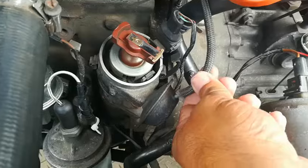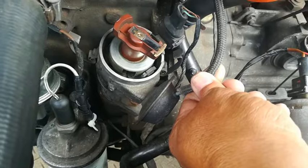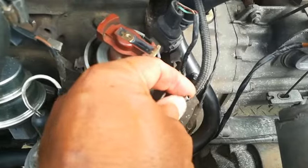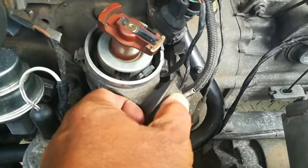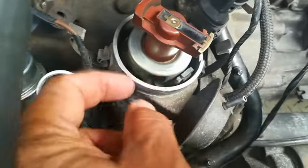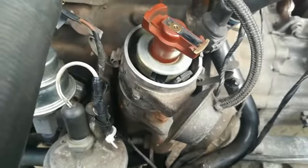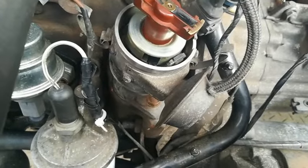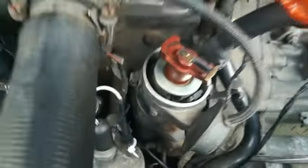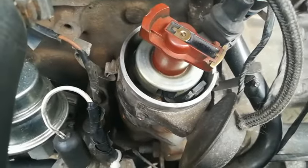These are tests you can do — you can just do a quick manual test by sucking up on the actual pipe. I'm going to show you how to do that now. One simple way to check if your vacuum advance is actually working is by taking off this pipe here and putting a smaller one on, then routing it to your mouth and sucking on it. When you suck on here, you will notice that this portion here will move. I've put the pipe onto the vacuum advance and I'm going to suck up on the other end.